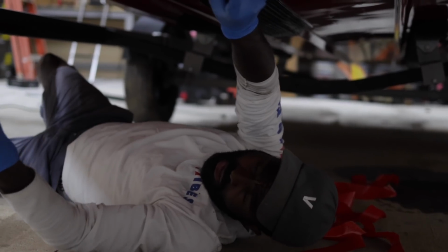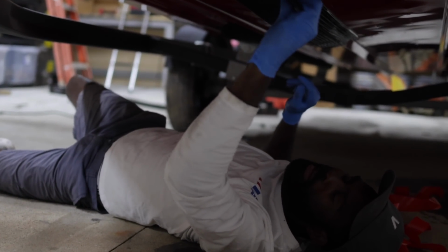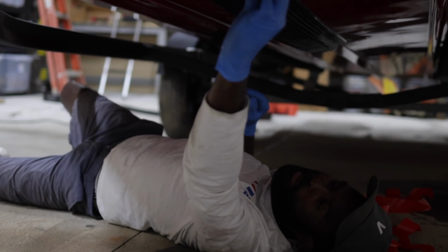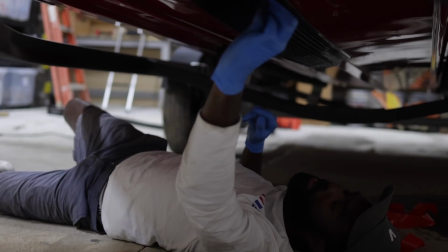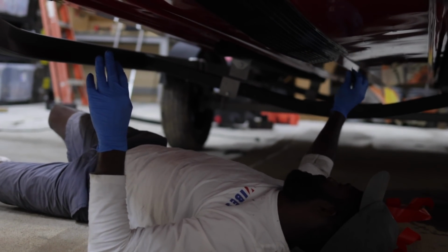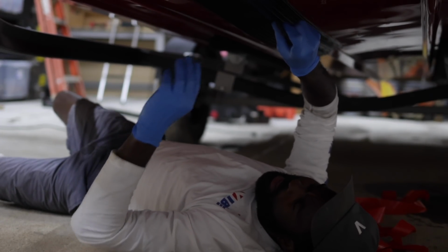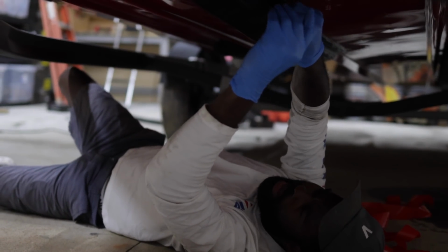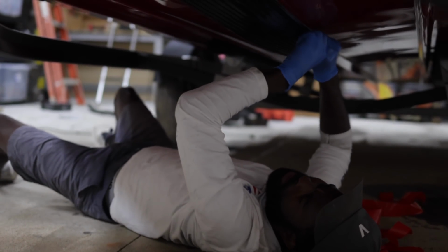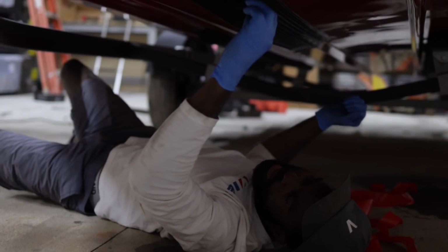One thing I like about the keel shield over other keel protectors, you see these ribs. At first I always thought these ribs were just kind of for looks, maybe for protection. But what it really helps with, and maybe they did design it for that, but I'm gonna tell you my personal perspective, not a corporate sales pitch here. Those little ribs are perfect for install. It does 2 things. It lets you put the squeegee in between there, and you get extra contact from keel to material, because you can push this in the middle of the splines and it guides you.